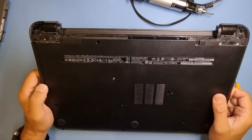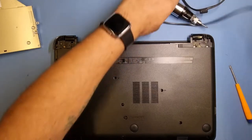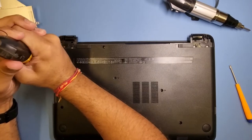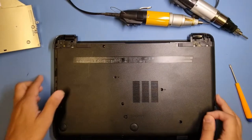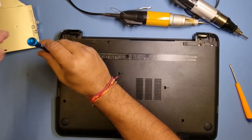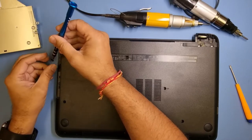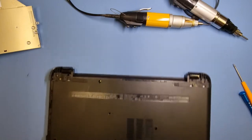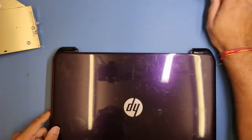Make sure there are no screws, then pull the CD drive out - that will reveal two more screws, and for once they're both there. Sometimes I open machines up and they're not there. That screw is pretty much stripped now, so I'm going to get my other tool. The head's rounded, but the electric one works most of the time even if it's not exactly the right size.